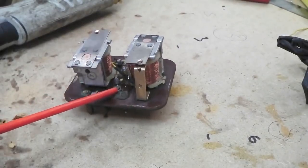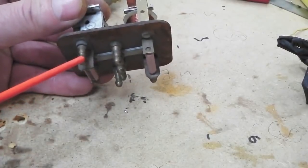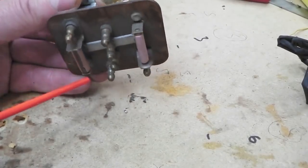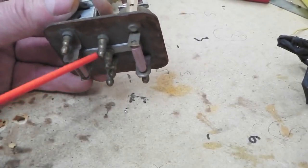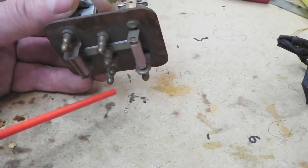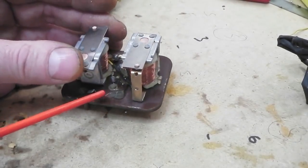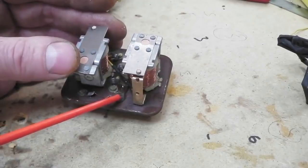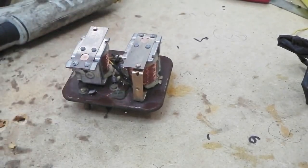Right, there's a little pad here, and this is one of the output pins. When the relay fires, that's your dips or your high beam output via the fuse there. See the fuse? So you connect your wiring harness onto that. There's a multi-plug in the middle, and then an individual single post connector goes on there for your dip beam or your high beam, depending. You can actually get them the wrong way round. But on it is soldered a little piece of copper winding, then a factory blob at the end that's broken away, dead ending it. No idea why that's there. It's not long enough to be winding for... I just... No idea.